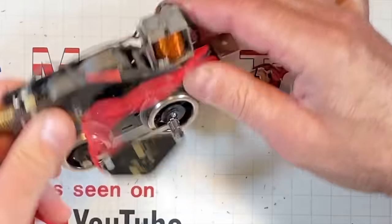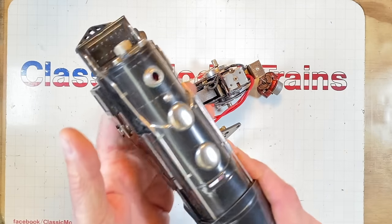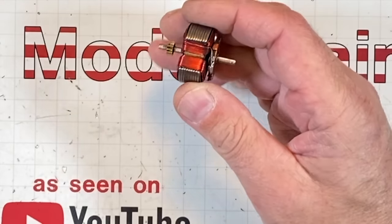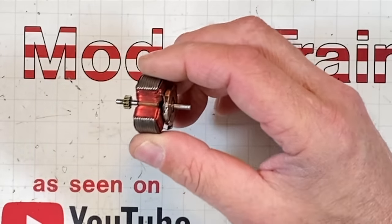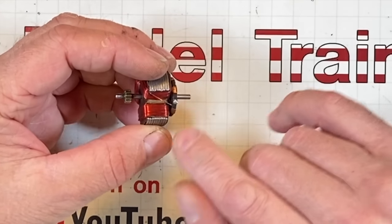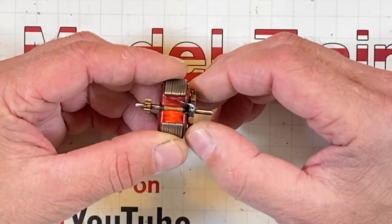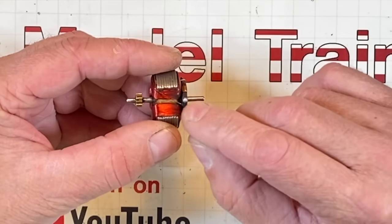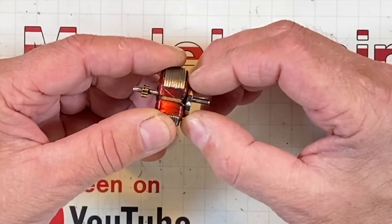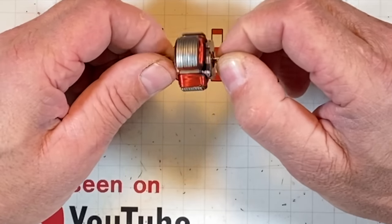Here's the armature out of this beautiful pre-war 259E. Absolutely gorgeous, well-preserved survivor. It keeps running and then it won't run. First time I found out one of the segments had an open in it - found a wire broken off, soldered it on, and it worked great. Then I was told it didn't work again. And now this one's broken off too. Why are these wires continuing to break off this commutator? Getting really close, you can see this electromagnet winding is loose on the armature shaft.